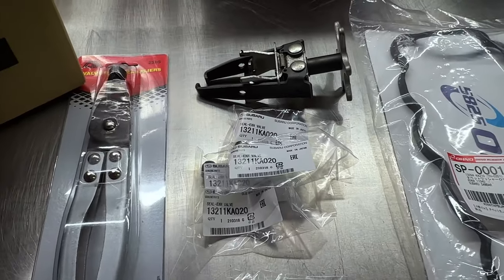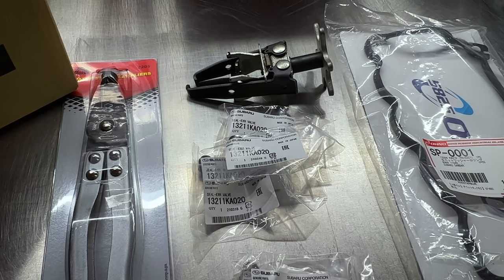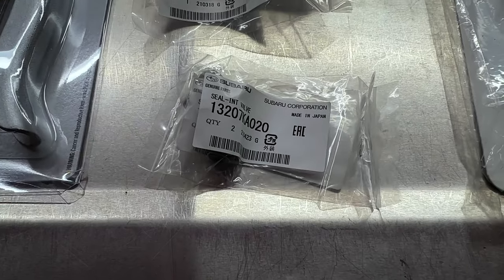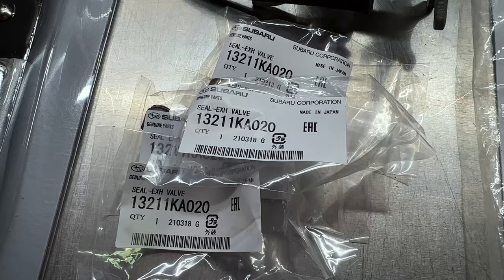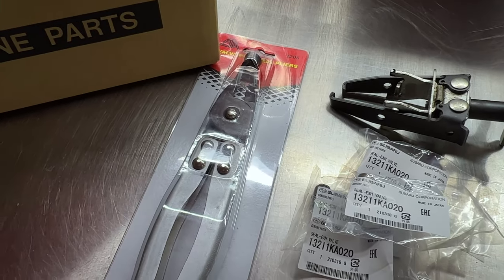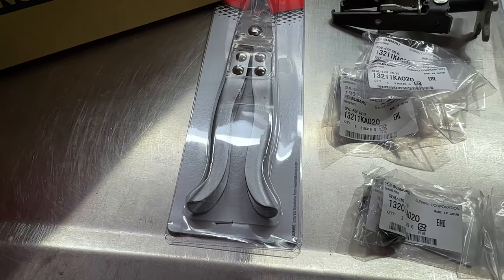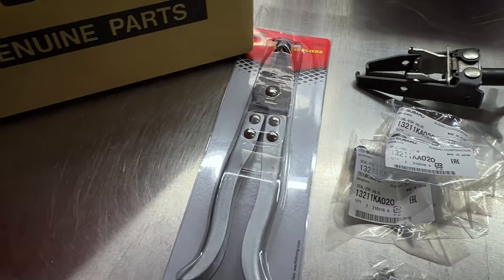We've got a universal valve spring compressor. I haven't used this on the Subaru EN07, so hopefully it works. You're going to need your new intake valve seals and your new exhaust valve seals, part numbers as shown, and they will be in the description of the video. We've got a set of CTA valve seal pliers. Not sure if they'll work with the engine in place or not due to their size, but we'll cross that bridge when we get there.